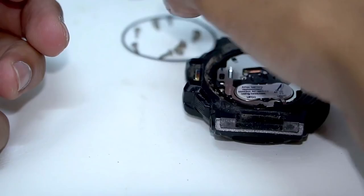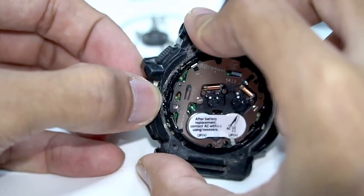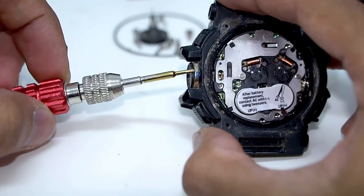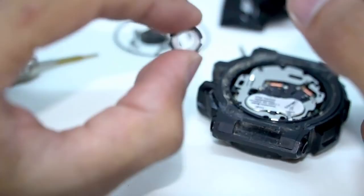This gold ring is a single piece because it's the gold and black colorway — yours might come in a different colorway. This part here acts like an o-ring for the crown since it is a movable watch; water could seep in there, so you need some sort of ring to prevent water from entering. The gold ring holds this black o-ring for the crown in place. Just pull this piece out using your nail, and the o-ring will fall out as well.